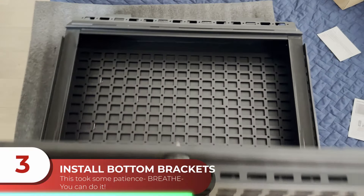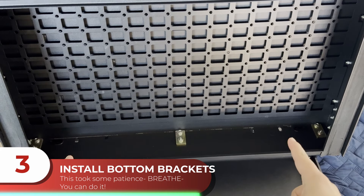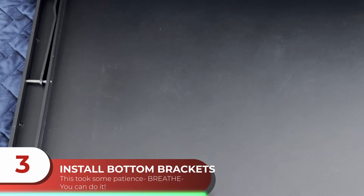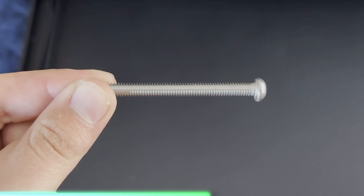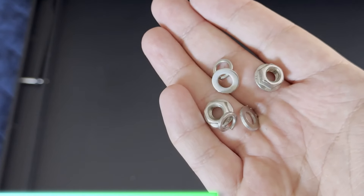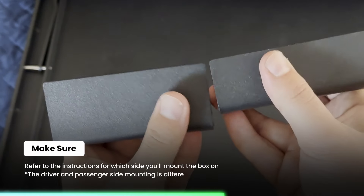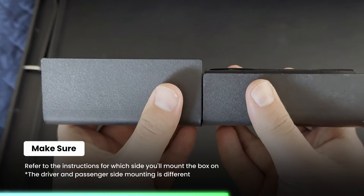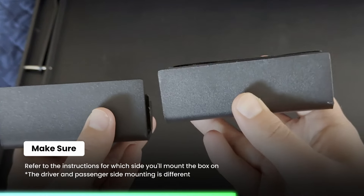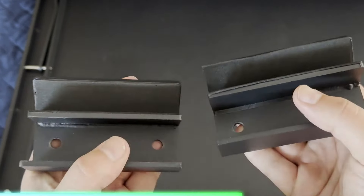Now it's time to open up the box so we can install the bottom brackets. There are two holes on each side of the container that you'll have to line up this metal piece with, and use the longer bolt in order to install the bottom brackets. Make sure you put your lock washer on first before your regular washer. This part is very critical because you need to know which side you're going to want to mount the box to, as that determines which bracket you use on which side on the bottom. With our driver side installation, we use the longer bracket on the left side and the shorter bracket on the right side.